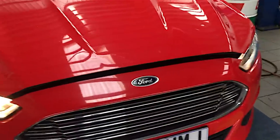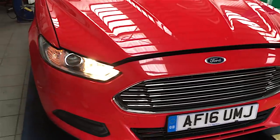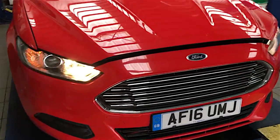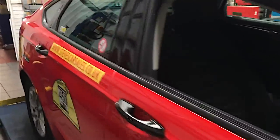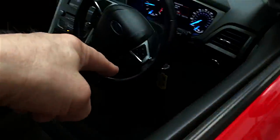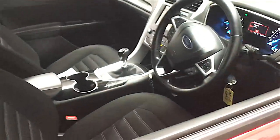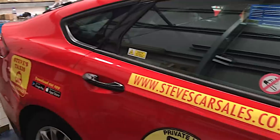That is pretty much my walk around the top half of these cars before I actually start a service, just going through the lights. Obviously, at the back, which I didn't mention, if you get somebody to put their foot on the brake, you can check the stop lights and check the reverse lights. However, you can switch the engine off and put it into reverse, and you can put a lever bar between the seat and the brake pedal to actually get your stop lights to work if you haven't got an assistant. But that's it, that's my general walk around the top half of the car.